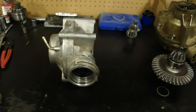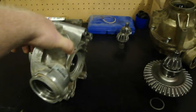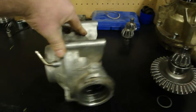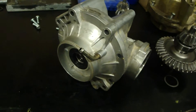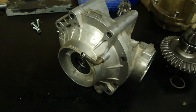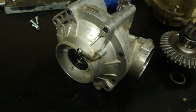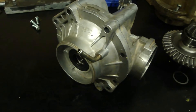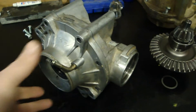Right off the bat there's a few differences with the case. Pinion seal and axle seals are new. Bigger breather tube — it's the same size as the XMR — and that sealing lid is a bit different too. It has a better sealing surface than the old G2 differential, again more like the XMR. So not a whole lot of changes there.